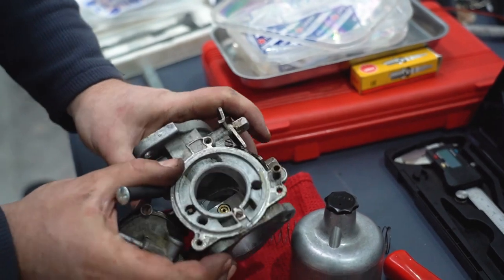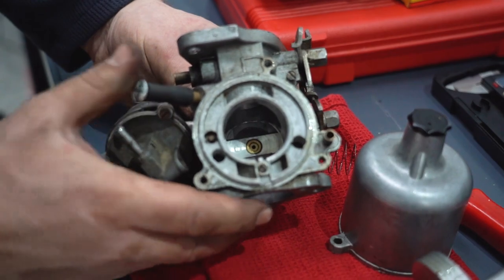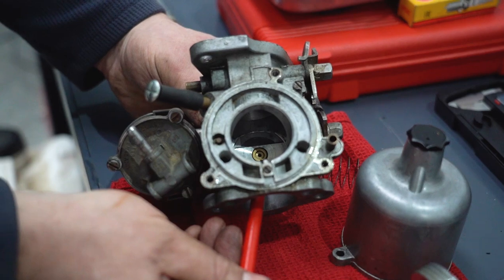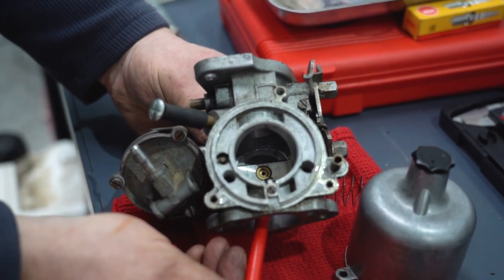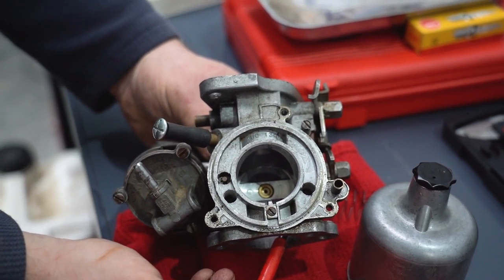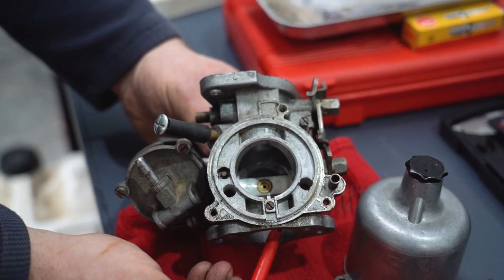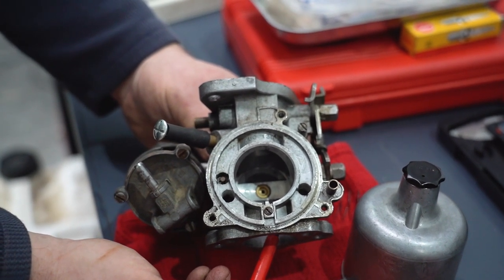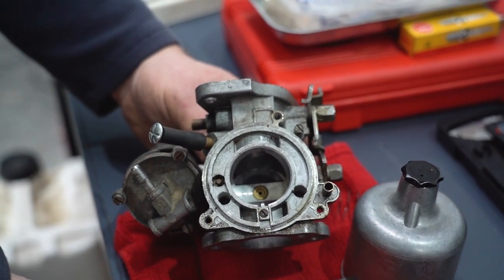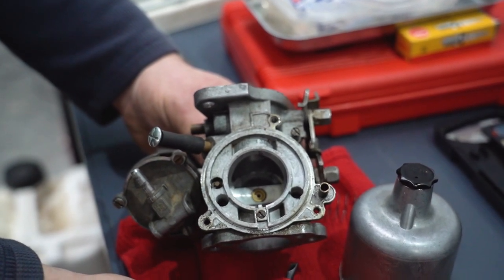The needle presents itself relative to the jet inside. The important part at idle is the outer brass collar here — it's the relevance of this position to the jet that controls the amount of fuel we're allowing to come through at idle. On the Mini behind us, we're going to set this up to exactly the right level. My thought at the moment is that it's running a little rich — but we'll prove that using another method also. The needle, the jet, and the jet bridge: controlling those gives us our idle mixture.